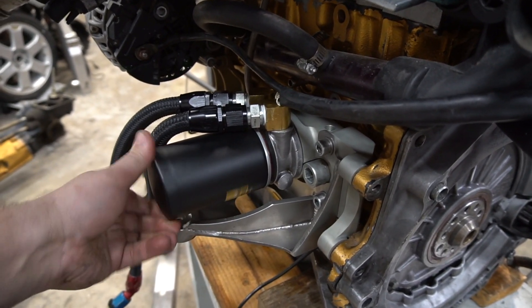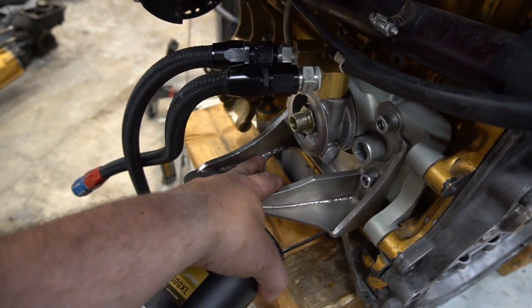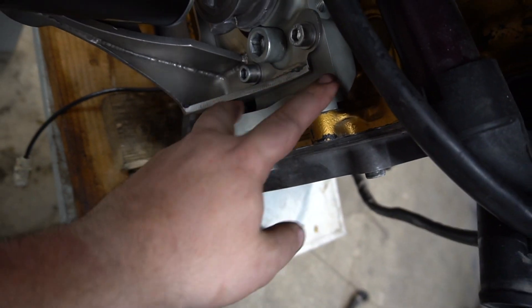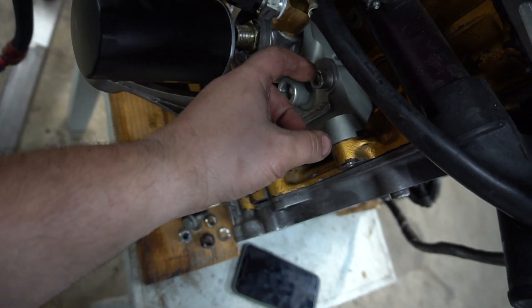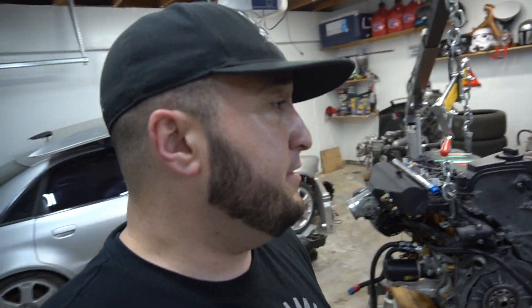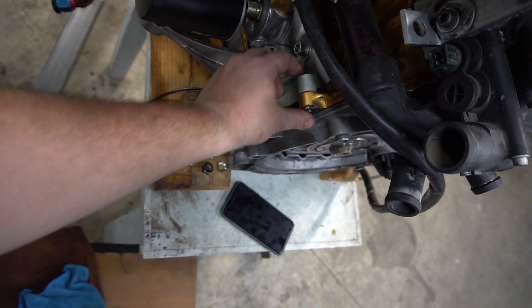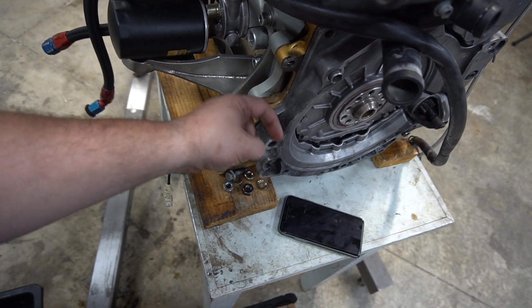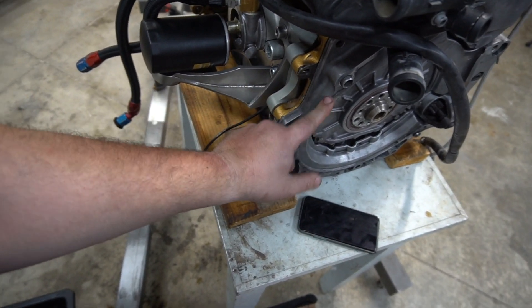You've got your oil cooler with the two fittings on top and lines going out to your oil cooler itself. And then you have your filter — as soon as you unscrew it, drop it down, let it drain, and you've got that really cool little ramp that goes in the bottom and drips right into your drip pan, so you can collect all your oil without getting it all over the place. There were two mounts here that we didn't utilize because they didn't include the hardware. I spoke to IBIT and they said everyone likes to do something a little different — they left it open. People may want to thread it, install from there, or slide a bolt through. I told them it would be advantageous to include those two bolts already in the kit and just make it an option. It sounds like they agreed, so these may be included to give you more mounting options and utilize every port on the bracket.